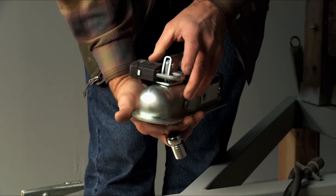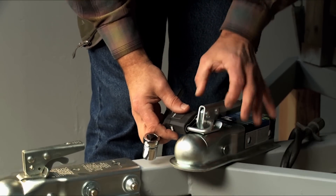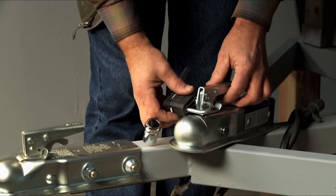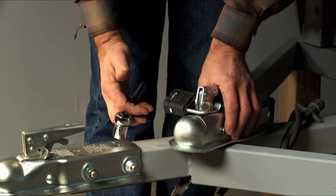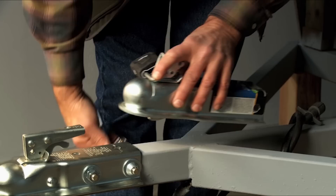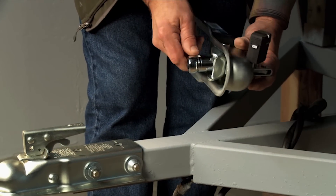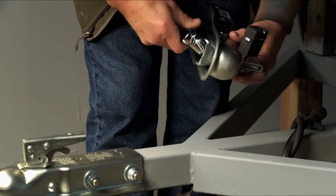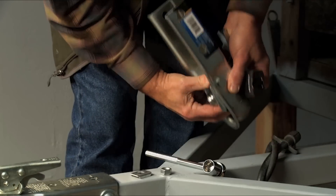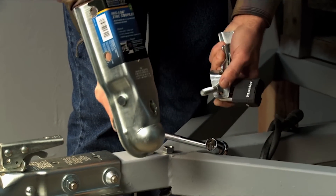In the anatomy of a coupler, putting on any type of lock that simply goes through the locking pin is a very low level of security, no matter what it's made of or who the manufacturer is. All I've got to do is go underneath the lock with a three-quarter inch socket, and once I back this nut off, the lock is completely disabled.